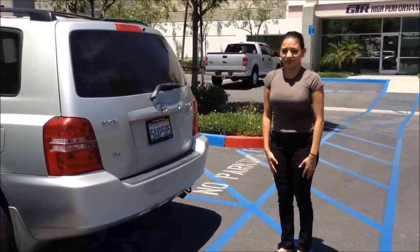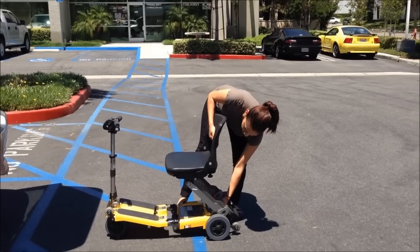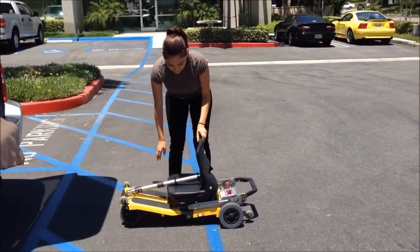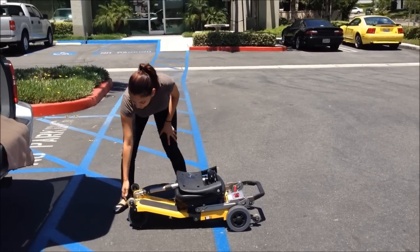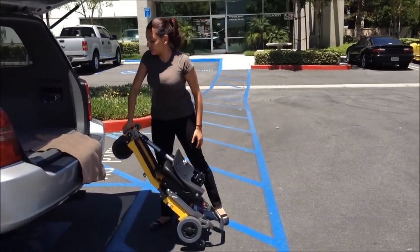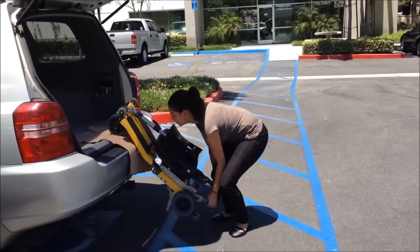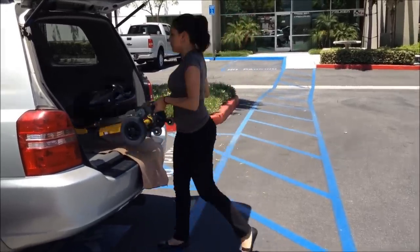Lastly, the easy fold — a combination of the previous two methods. You simply drop the seat and lower the tiller. Drop the backrest on top of the tiller; the top console should fit in the gap between the backrest and the seat. Raise from the front end, rest against the trunk, lift from the back bumper, and wheel into the trunk.